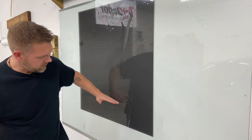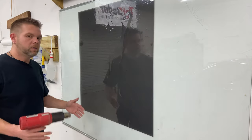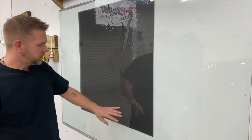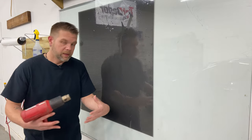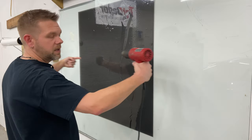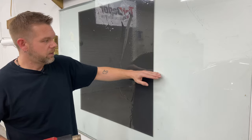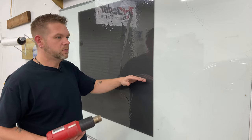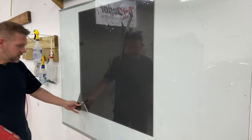So as I'm shrinking, you see these horizontal lines going this way, kind of a zigzag — that's the film pulling in and shrinking. When the film shrinks, it will actually pull in from side to side as you're adding heat to it, hence shrinking the film down and creating a curl or curve. It can't do it on the side because it's actually pulling from those two ends — it's coming in this way. The film has to have sort of a back and forth, it's got a pull and tug. If there's only one way right here, the film's not going to be able to have another direction to pull in.